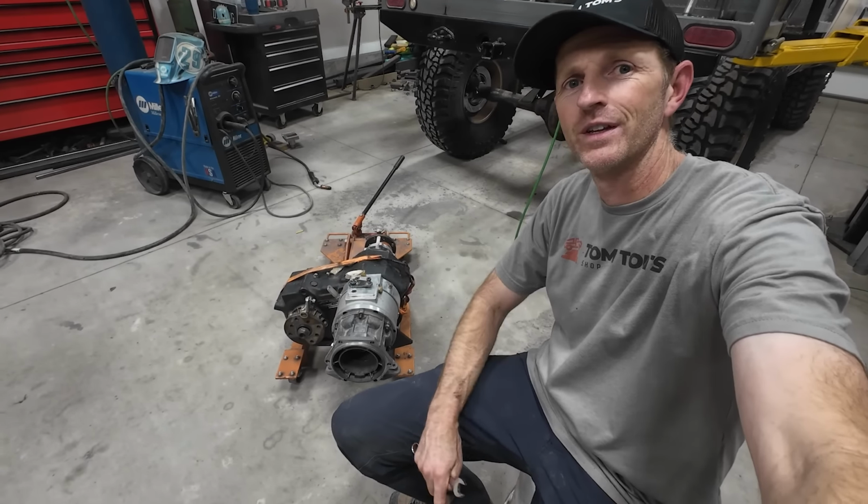I might cut it down this way, like a quarter of an inch. Oh yeah, that's gonna weld in there beautifully. Okay, this is the plate that I've built, and I'm just reinforcing this area that I've already welded in. I'm just adding extra weld between this truss and the axle housing. Because this is cast iron, it likes to be welded really, really hot, and I'm just gonna weld the bejeebies out of it.